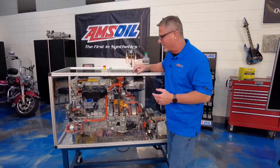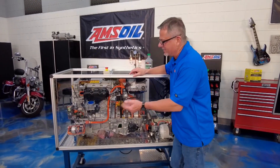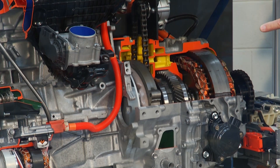Everything just like you thought it was — you have pistons and everything. The problem is you have low compression and a very small horsepower engine. Then we come over here: you have your transaxle, but in the middle here, this is the electric motor assist. This is where we're actually assisting the car with this electric motor, making it a hybrid.